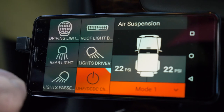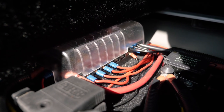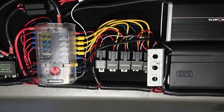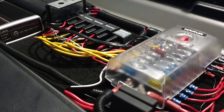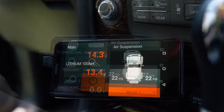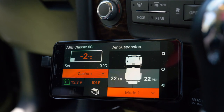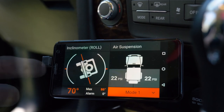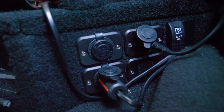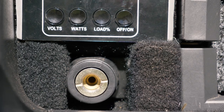One of the things I love doing with vehicles is wiring them up, and I take a lot of pride in getting all the wiring right and getting the 12-volt run to the back of the car. In the back of my vehicle, I set up all the 12-volt panelling and bought a system called ARB Links — basically a module where everything plugs in and communicates to the Links on my dashboard. All I had to do is get 12-volt to it, an ignition source, and a reverse light, and now that's my module for every accessory I bolt on after. I went to a 100-amp lithium battery in the back, a DC-DC charger made by Projecta to power it, and a Projecta 1000-watt pure sine wave inverter — plenty of power for all my 240-volt appliances.